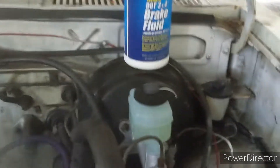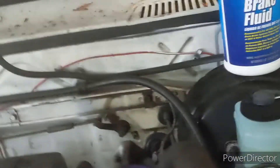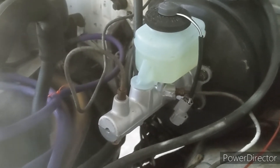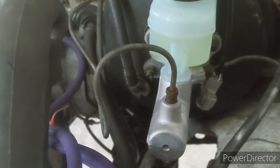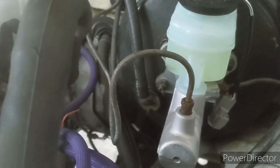Next up — booster and master cylinder, both FJ80. Here's the trick: I put the FJ81 next to the two-wheel-drive Hilux and they are identical — length, height, hole in the firewall, mounting bolts, shaft length, clevis — except flipped. So this is an FJ80 booster that's literally flipped and bolted right on with the FJ master cylinder. Vacuum doesn't care if it's upside down. We've been putting flipped boosters on old trucks forever — taking newer Toyota ones, putting them on FJ40s. They bolt right in, good to go. It's totally safe and fine.